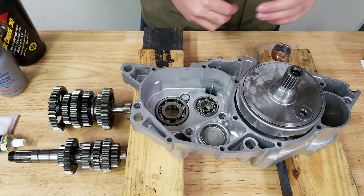The right shift fork goes on top — same thing, you want those pegs facing towards the shift drum. So put the 'L' fork in first, then the longer shift fork goes down, and you just fish things through until everything lines up. Now that the transmission is in place, this is the time to make sure everything is working properly — not after the cases are back together. They recommend doing this with two people, but I managed fine.